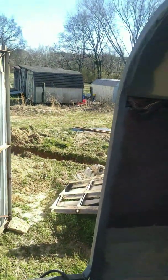Like here, this is where the gap was. It's all been filled in, fiberglass shoved in. Here is hardened, another coat's been put on, another coat will come in and fill this, or I can round it off, and I'll bring it back past the metal, so there's no give in this corner.